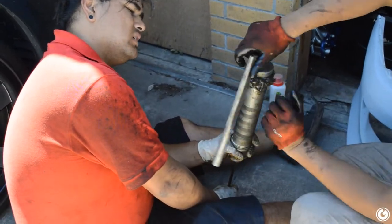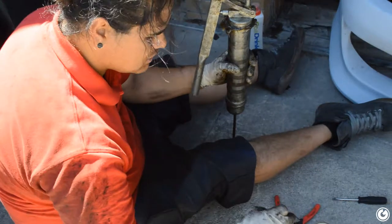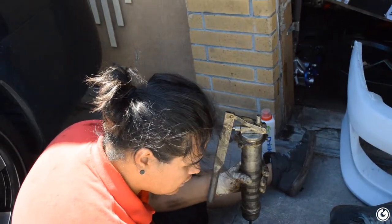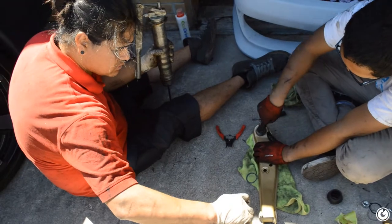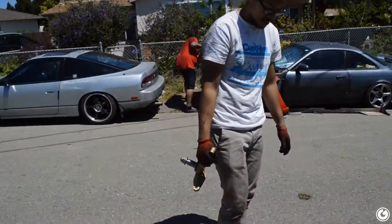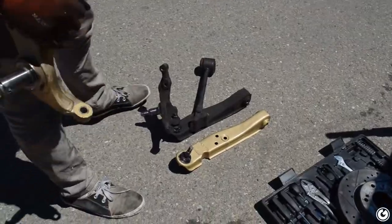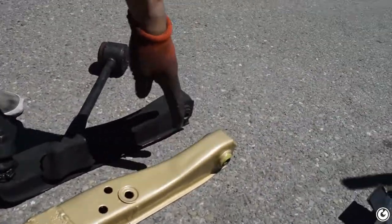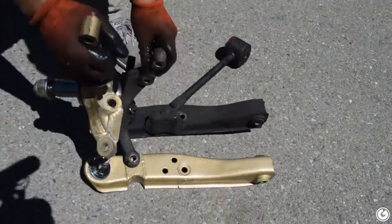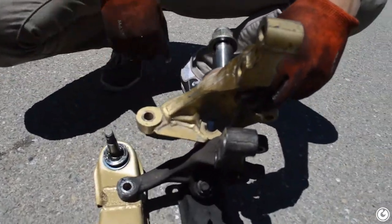Alright, we got it. We put a little bit on the top. We still need to figure out how to get grease into that nipple - we don't have the right adapter. We got one side done. Here's what the angle entails: it's extended from the lower control arm - that's why these are cut and welded with a little notch so you get more angle. And the knuckle itself is a lot shorter. The guy I bought it from shortened it and plate-welded it for more reinforcement.